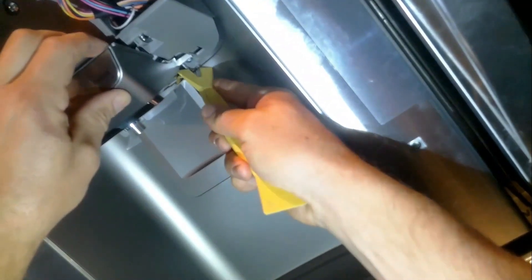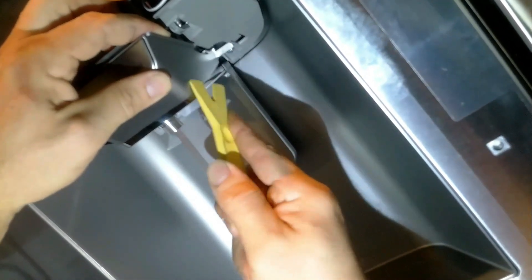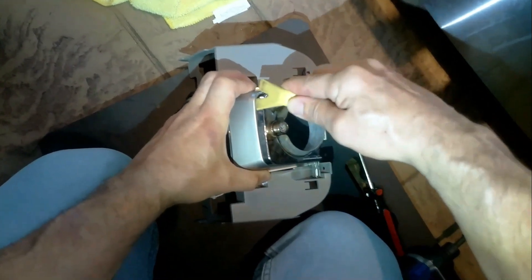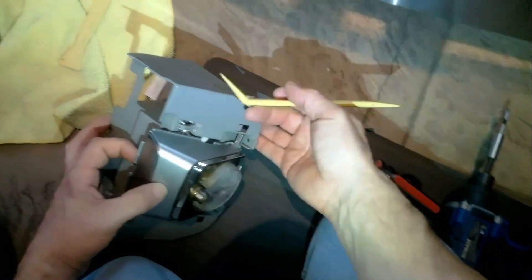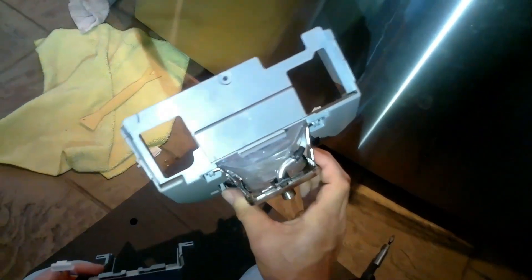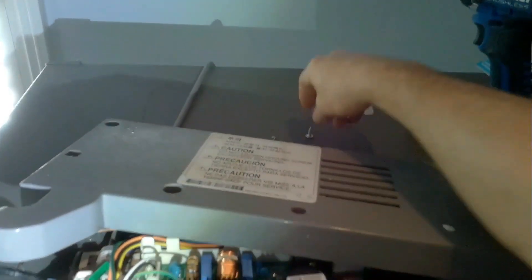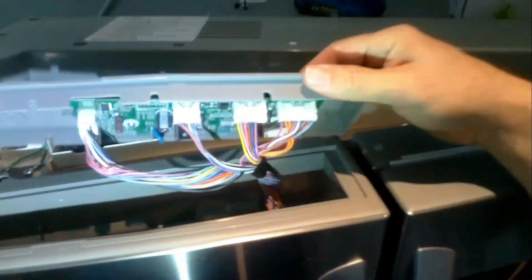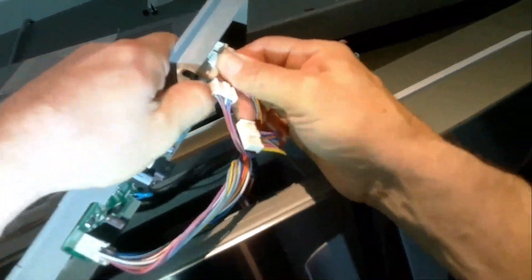There's one more part of the display you have to remove. Put it in there, make a little gap and pry it out. You have to go upwards and out and then just slide it forward — start up like that and then in and pull out. That's how it should be done. That's a little harness and everything — that's one piece you would definitely have to remove to put on the new door. This is another control board — way simpler, it's just one Phillips screw. This is on the top of the door. You'll also have to put this in the new door. This is what controls the water, ice maker and so forth. Just remove all the harnesses and put it somewhere out of the way.